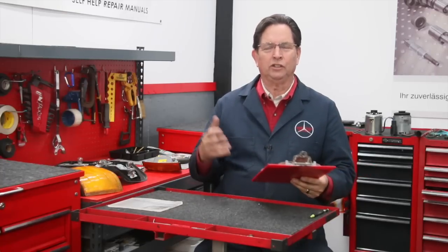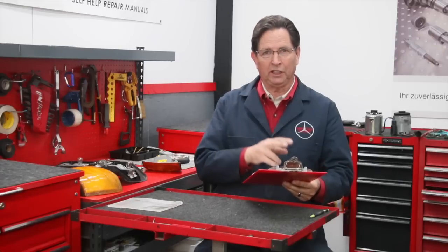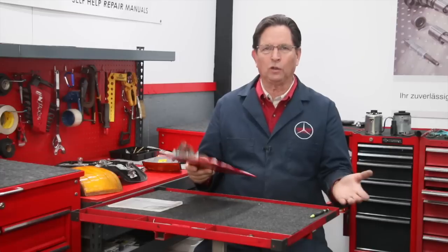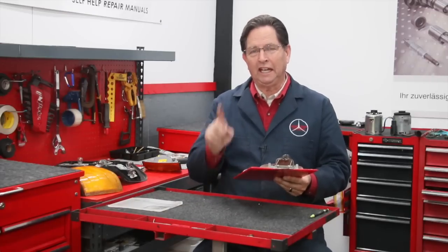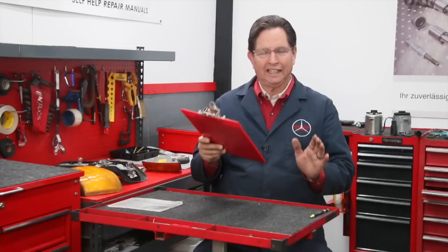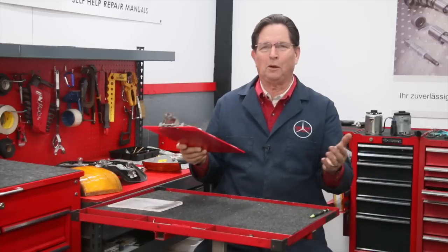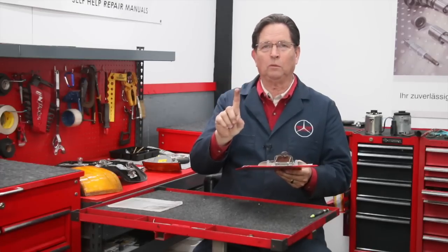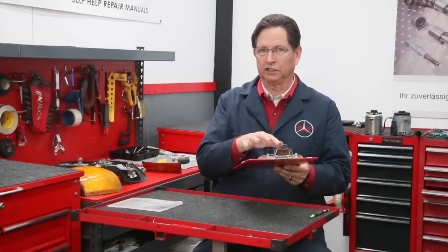This is a non-tilting sunroof. The tilting sunroofs have a lot more mechanism and require probably twice as much lubrication as the non-tilting sunroofs. I think you'll have to admit that was a great illustration of why you need to remove the sunroof panel in order to lubricate it properly, particularly if it's over 20 years old. Under 20 years old you can probably get in with a brush and smear some lubricant on the tracks, and that'll certainly help. But when they get over 20 years old, they start building up that tar and gum and the pads get all impacted. I have a complete set of on-demand videos on my website about the tilting sunroof, plus manuals and video on the non-tilting manual sunroof. In part one of the tilting sunroof series I covered emergency panel removal — that procedure for getting the panel unstuck is real similar to the non-tilting sunroofs as well.